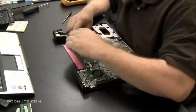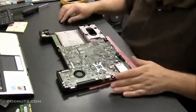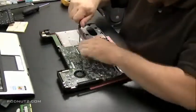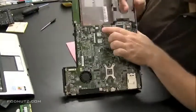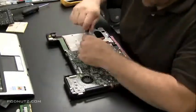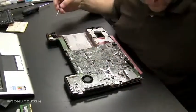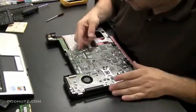If you see what we're dealing with here, the power jack is attached to a separate circuit board from the motherboard, and this is good for us. Let's get the motherboard out and then we'll hit that separate board. I was just pointing to a white arrow on the motherboard — the white arrows are usually on the motherboard to show you which screws you need to remove. You don't need to remove every screw on the motherboard to get it out, only the ones the white arrows point to.